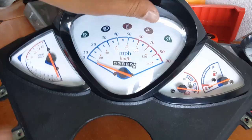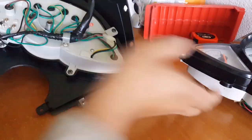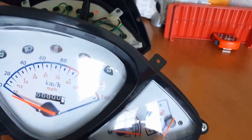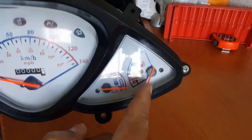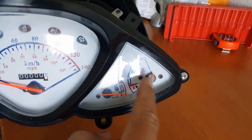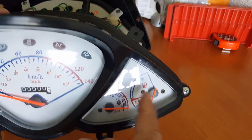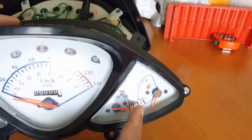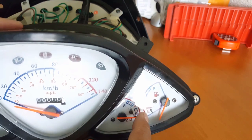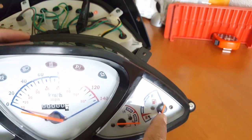So this is how we actually remove it. If you have an Interceptor 150, this is a simple fix where the gauge here — all you got to do is twist it back around here. Don't try to go over this bar, it doesn't need to be. When it springs around here, it will actually create a spring again. You have to turn it counterclockwise back up and it'll forcefully go back down on its own — magnetized or whatever the case. There's a little spring that resets the needle itself right here.